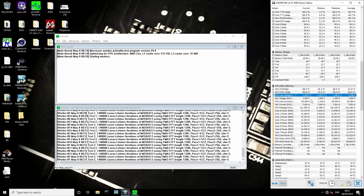From a safety perspective it's fine, because all of the usual thermal limits are still there. It's just that you told the CPU: if you're not overheating, you can use more power. It's still at 90 degrees and the stock thermal limit is at 95, but it is running hot. The CPU is not going to go above 90 on its own — now the power consumption is coming down a bit.